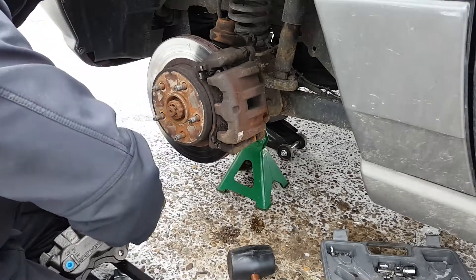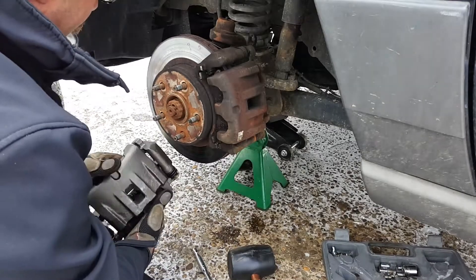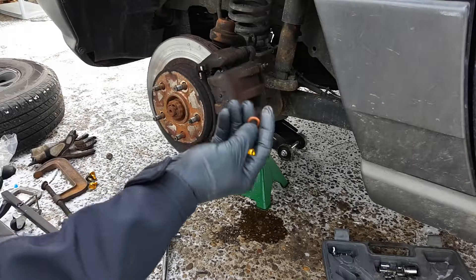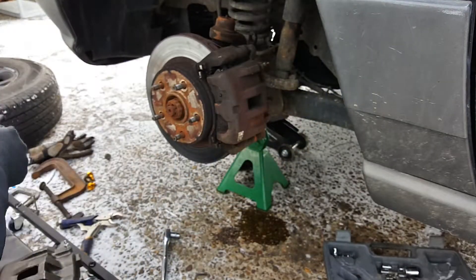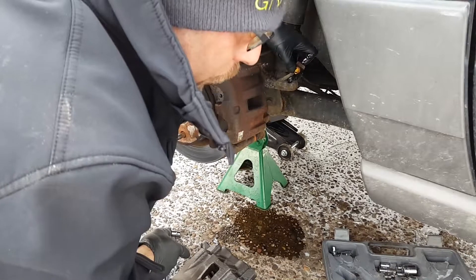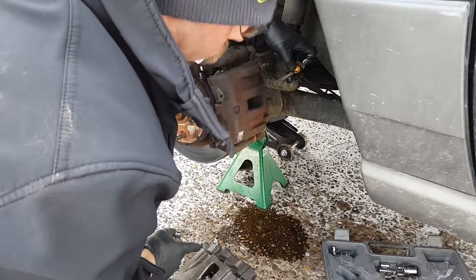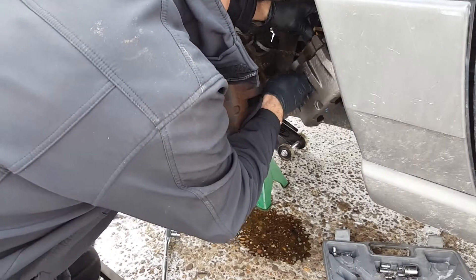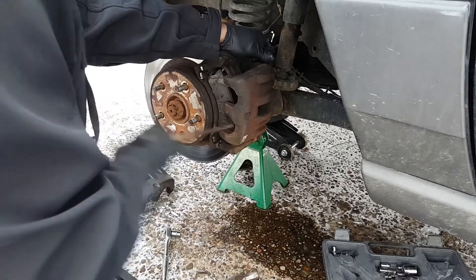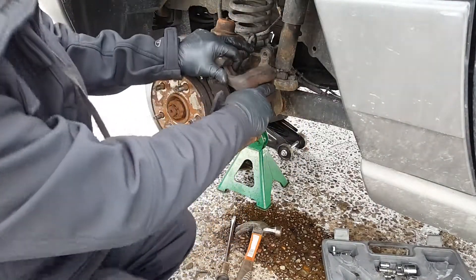Now I'm going to remove the old pins and put them aside. Don't forget the copper crush washers — these will seat and crush. Washer on the outside, washer on the inside. If you don't do it right, the fluid won't go through the hole that goes through the caliper. I believe these calipers are only a year old, too, and the rotors as well.